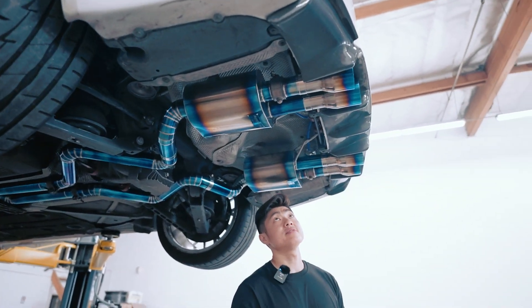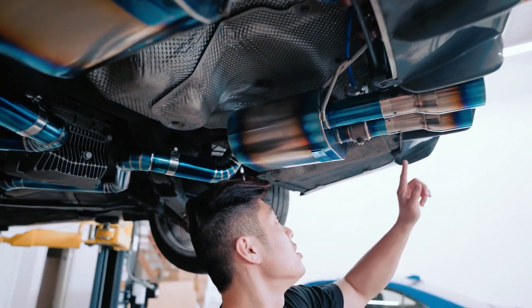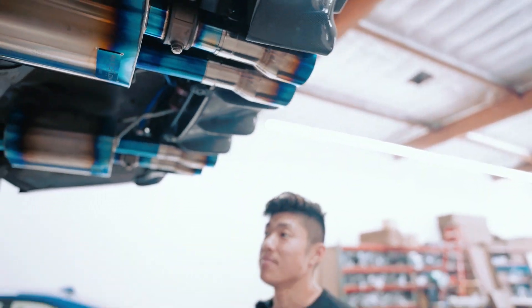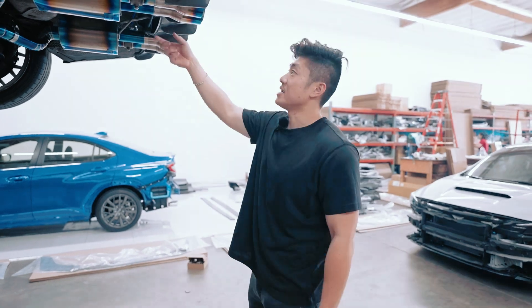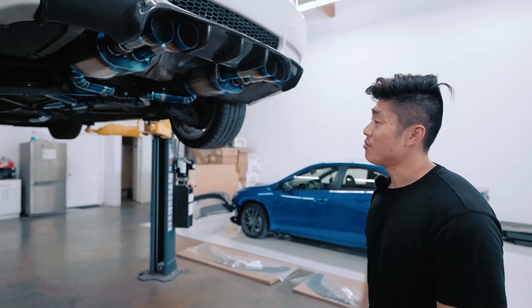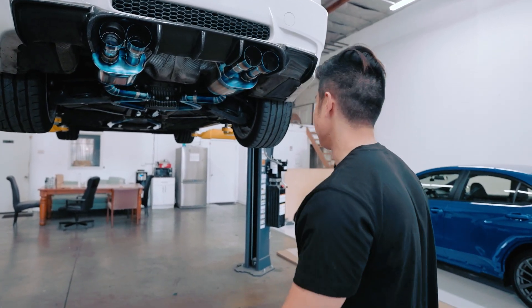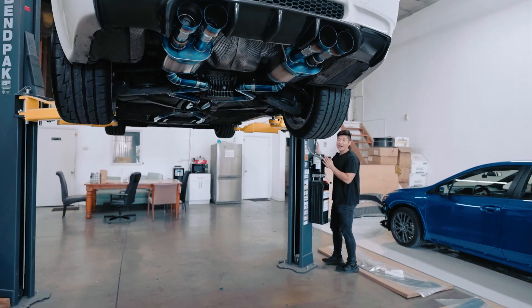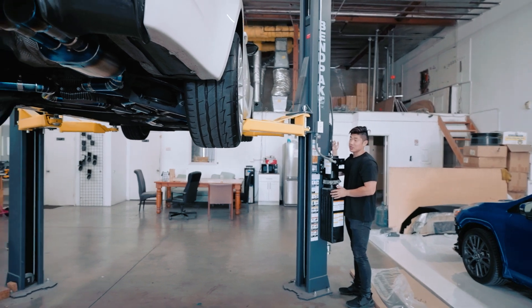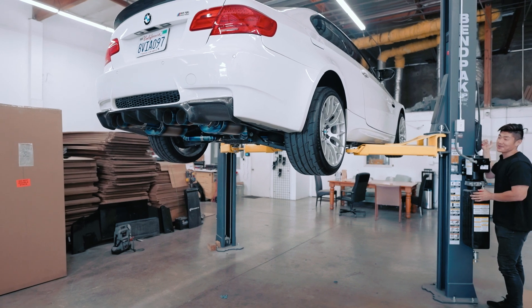For the wiring for the valves, Kevin had to go, so I did it myself real quick. I kind of wired it through the rear wheel well right here, straight up. The box is in there, which I'll show you in a bit. Here's the final exhaust — the tips you can adjust a little bit depending on what kind of diffuser you have. By the way, this is a non-resonated setup, guys. That means there's no resonators, nothing, no cats. It's going to be hella loud — I think. I don't know yet.